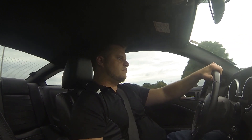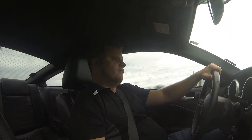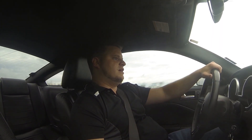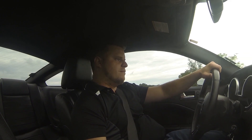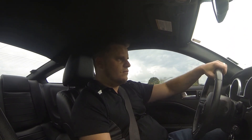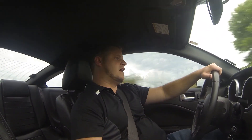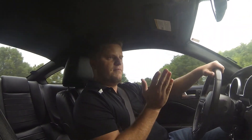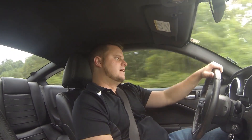My personal feeling is it's a hard toss-up. I did it mostly as a cooling additive, but I actually lost horsepower when I put the methanol injection on. I lost 15 horsepower — on the same dyno it made 516 to the tire with methanol, then I unplugged the fuse and it dynoed at 531. It's not tuned for it. Justin said he thinks my nozzle was too big and that my boost setting for the pump to activate was coming on too soon. I put the smaller nozzle on and set the pump to come in at around nine pounds of boost now.